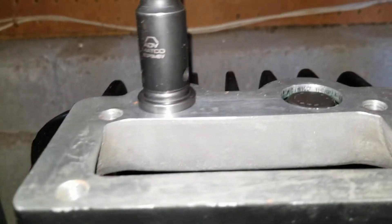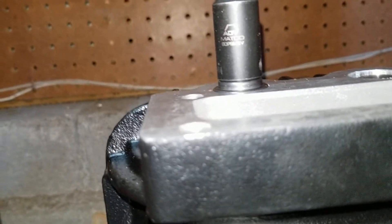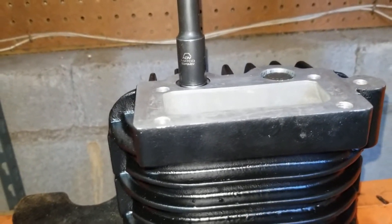You're just going to keep going down making sure it's straight — it's going in nice and smooth. Get it about where the other one is and start taking your measurements; that was eighteen thousandths of an inch.